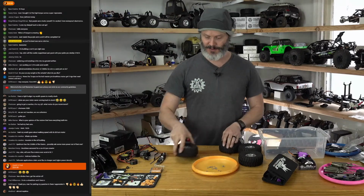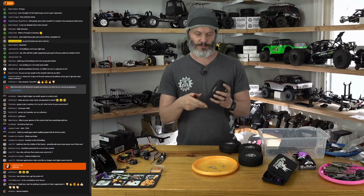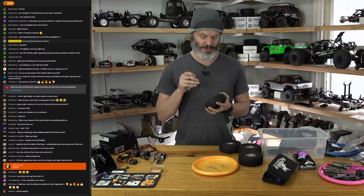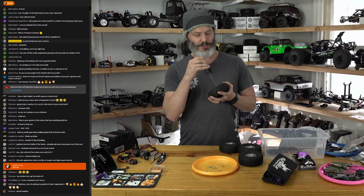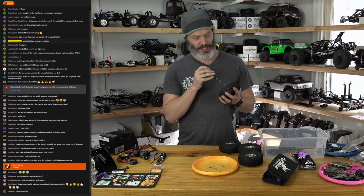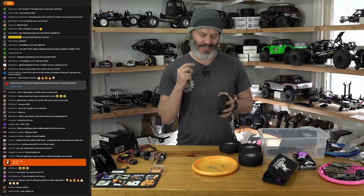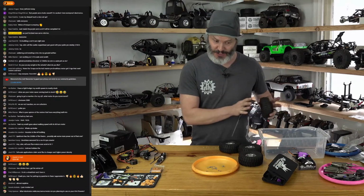All right. J-Rod's got a question. He says, will the axial flux motors ever exist in RC? So I've done simulations on axial flux motors. It is not impossible to build a motor of the same volume as a typical 540 with axial flux. Let me start over. You can use the same frame size as a 540 using axial flux, and you can get the same amount of power density and torque density for the most part.